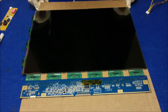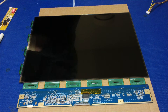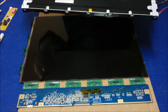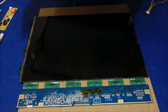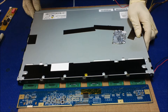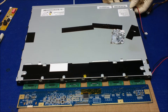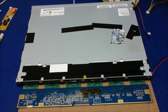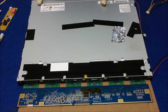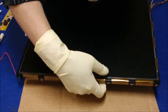Make sure it's clean. Look at the back — the screw hole here tells you this is the right direction. Slowly put it on top. You see those tabs — be careful with them. Try to lift up, get your hand underneath it, and hold the liquid crystal glass, then slowly hold it together with the backlight assembly and flip it over like this.